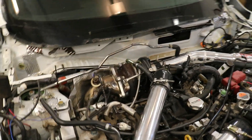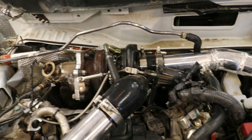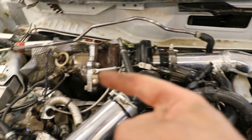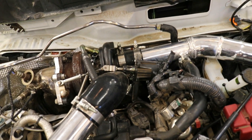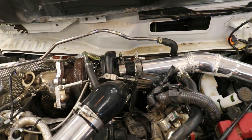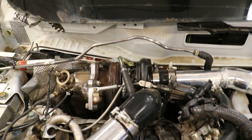Alright, I just got back from taking it for a ride. I have to say, these V2 higher compression engines spooled that turbo up a little faster than the V1s did, that's for sure. There are no leaks or anything like that, so that's good — everything held up. For those of you playing around with these at home, you would think the actuator is pulled in all the way at its resting position, but it's actually not. It sticks out just a tiny, tiny bit. So I had it adjusted wrong, which is why when I started it up it kind of shot that way. But it's all set now. Under boost it actually sucks back in a little bit when it starts seeing positive pressure, which seals up the wastegate — I'm assuming that's why they did that.